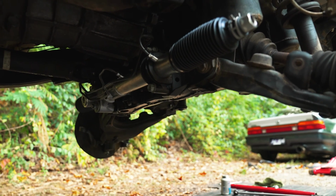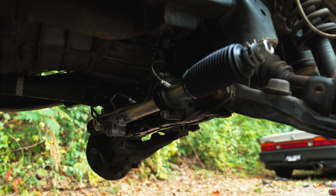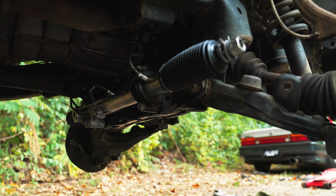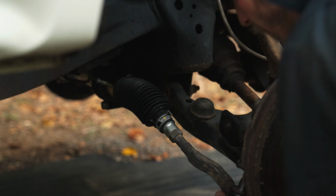New power steering rack is all bolted up. I've got the hard lines on, all of the mounting bolts for the rack done and torqued down. It's mostly 123 foot-pounds except for the driver-most bolt. That is 141 foot-pounds, I believe.